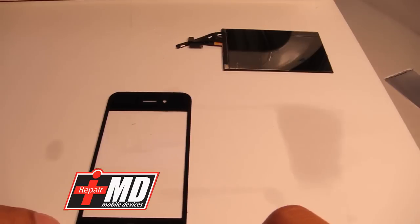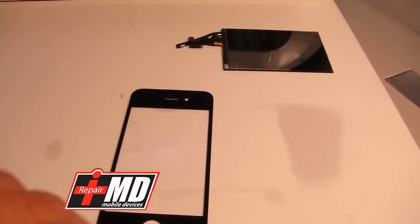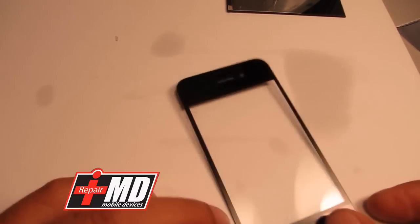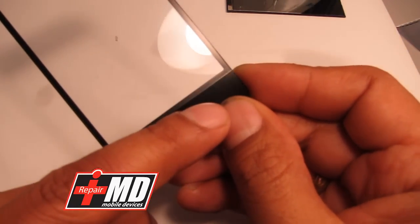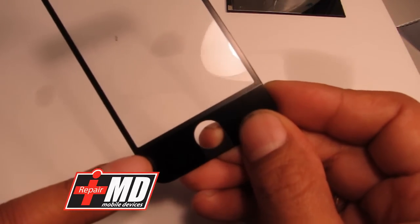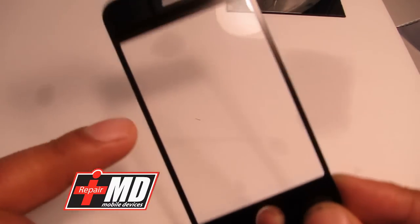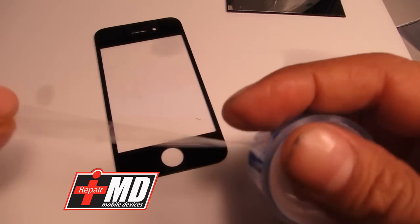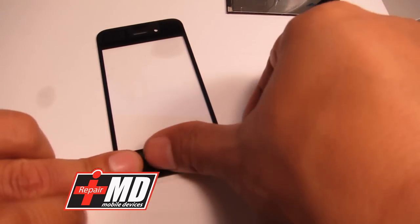On the iPhone 5 and 4S original glass, you'll notice a little gray area — I'll bring it really close so you can see. Right there is where the display is supposed to meet; that's where it's exposed. Instead of glossy, the black is kind of matted at the top and bottom. I'm taping it below that area, putting my clear tape right here, right below — that's where I actually want to mount my display.